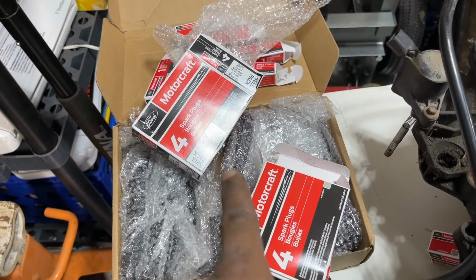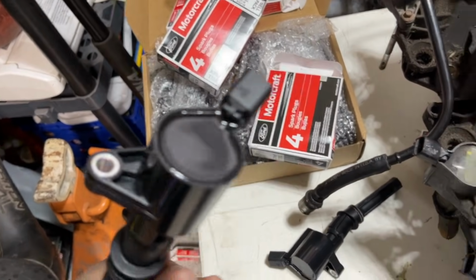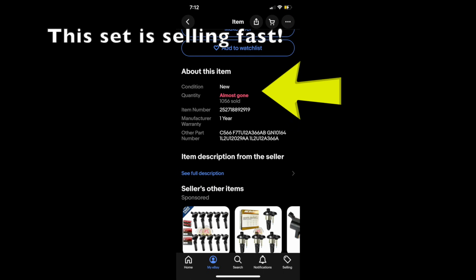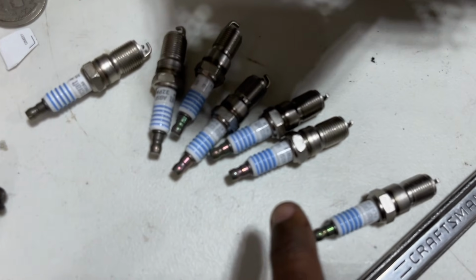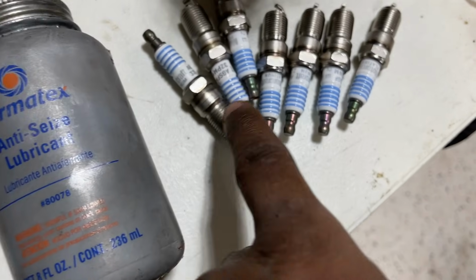I'll put the link in the description box for this little kit for the Motorcraft spark plugs and some aftermarket coils. Just replace this since you're saving money buying this part. Change out the spark plugs. You can also use a little anti-seize on these spark plugs. Just a dab on each one of the threads.